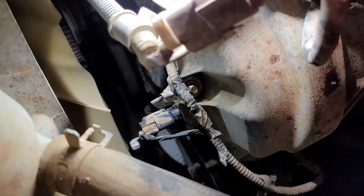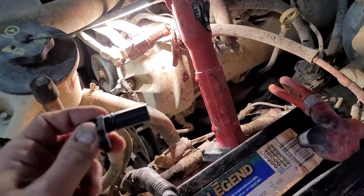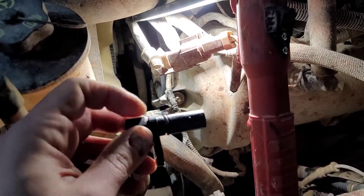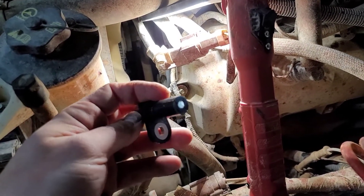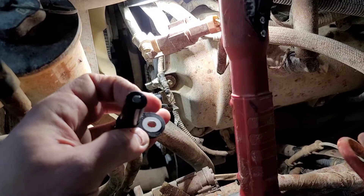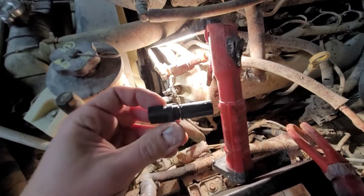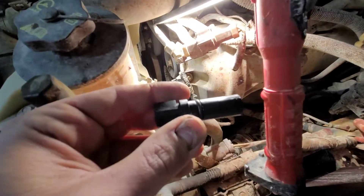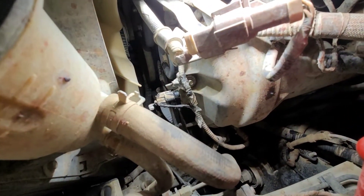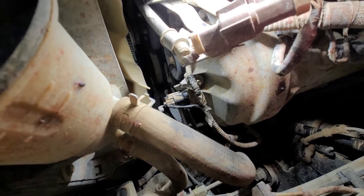Now, what has happened to this sensor — I sprayed a bunch of brake cleaner on it earlier, but it was completely covered with oil residue. How a camshaft position sensor works: this is the new one I just got from Napa. These plug right into the front of the cylinder head, and on the end is just a big magnet. They're basically hall effect sensors — the magnet counts the teeth on the camshaft sprocket, and by how fast those teeth pass in front of the magnet, the computer determines engine speed. When the O-rings fail, oil seeps past them and gets into the electronic circuitry. This entire thing was completely coated with oil — the O-ring has probably torn or worn out, blown out the electronics inside.